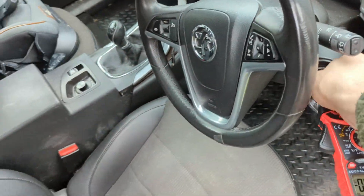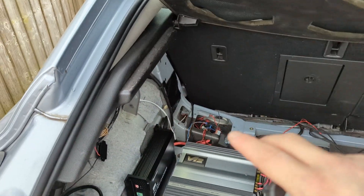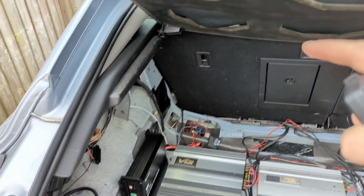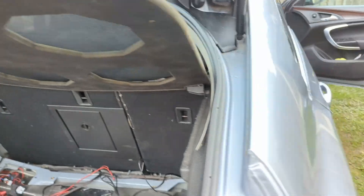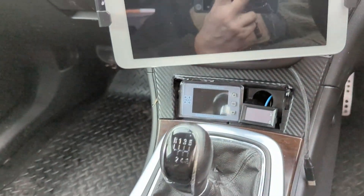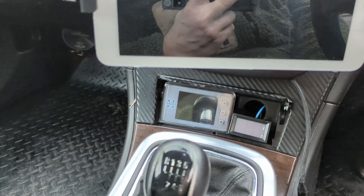I'll turn off the engine because it's a very loud diesel. The discrepancy is because of the wires running to the front — it's a 100-amp shunt, and the wires add resistance to the shunt, making it read incorrectly. It shows 34 but in reality it's 22 — about 10 amps more than actual. Sometimes it shows 70 or 80 amps which is also not correct. But it's still useful for monitoring as long as you know it's not calibrated.